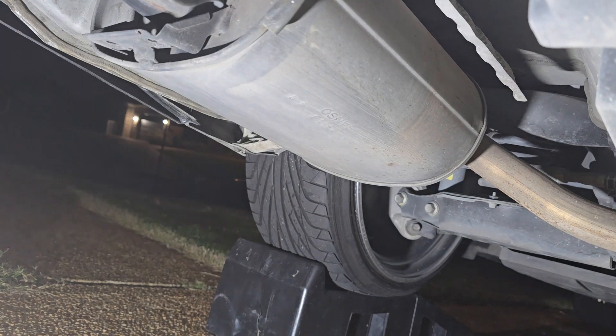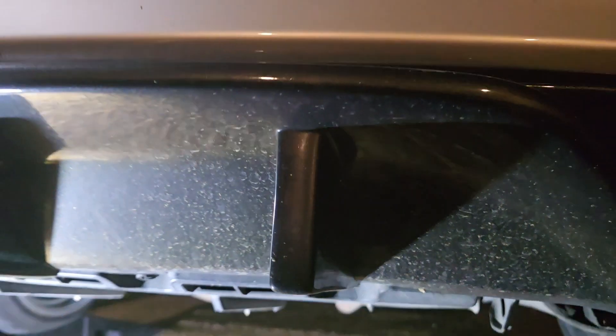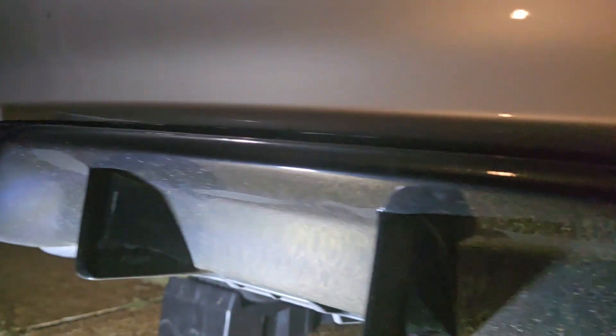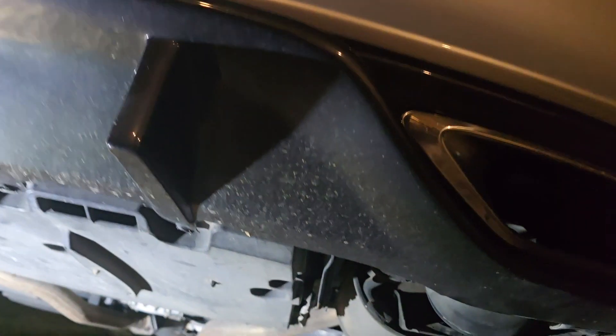So what I'm going to do is take those two bolts out and slide the exhaust hanger. There's one there, there is one here, one on the opposite side. I think that's it and then the exhaust should come out. I'm gonna do the same thing on that side and then replace it with the aftermarket exhaust. By the way, if y'all been paying attention to the shorts, you saw that I added this thing — didn't do it on camera. The exhaust looks really good in my opinion. Welds look really nice, great craftsmanship.